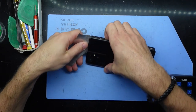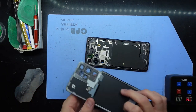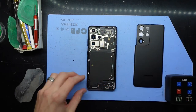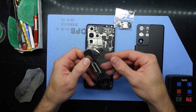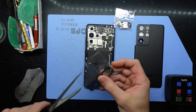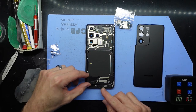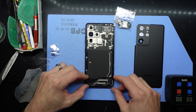Now we're nearly at the stage where I'm happy to fold it like a book, slowly lift, fold it over — and that's retained most of that adhesive. I'll keep that on my heat pad to keep it warm and tacky. The phone is currently switched off. The reason for the loudspeaker replacement is that it's currently faulty and producing a very tiny noise, so there's not much you can do apart from replace it. I've put the replacement one here — the model number looks to be slightly different but at a glance it looks like it should be okay.